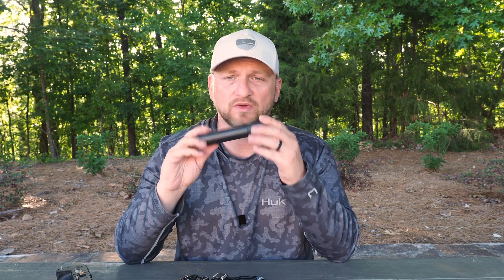I may film for an hour or two one day and then two days later pick it up and film something else without recharging it, and I've not really had any issues. I can recommend this one, but if you have a brand you're loyal to like Anker or RAVPower — any brand you're comfortable with — you just want something that has PD power output that hits the 9-volt 3-amp power threshold. That's the first thing you need.